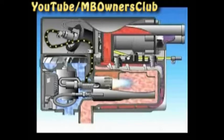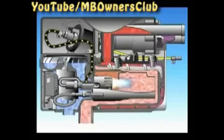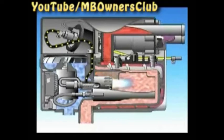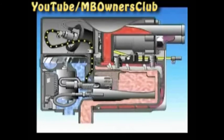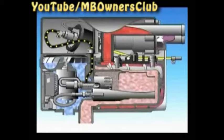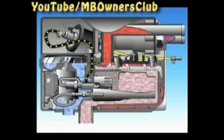If the water temperature nevertheless rises further and reaches 85 degrees Celsius, then the device is switched off. In this case, the fuel supply is interrupted and the flame goes out. The heating appliance is in the run-on mode and the water pump keeps going. If the water temperature sinks to less than 75 degrees, the heating appliance starts once more with a high heating output.